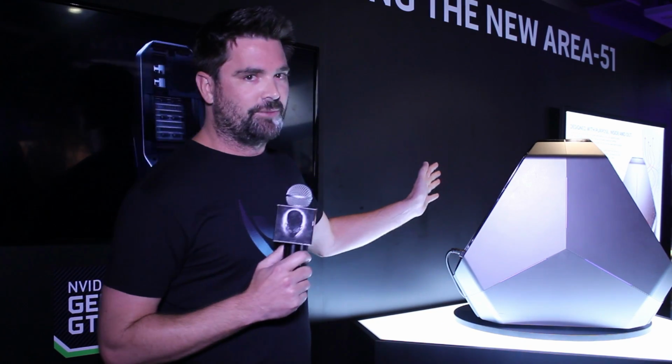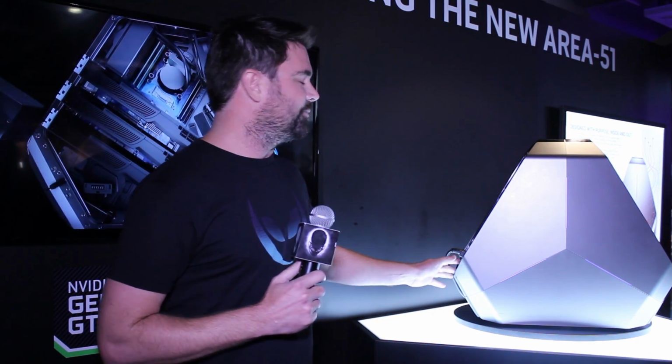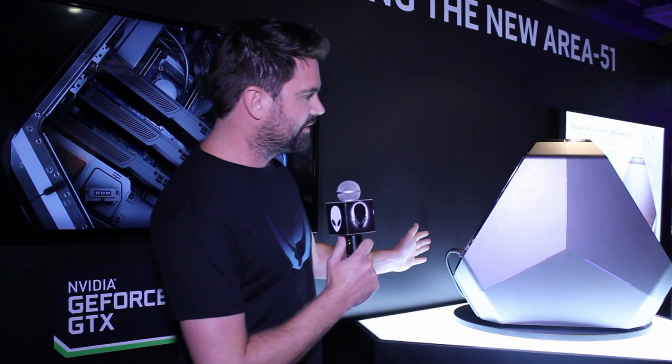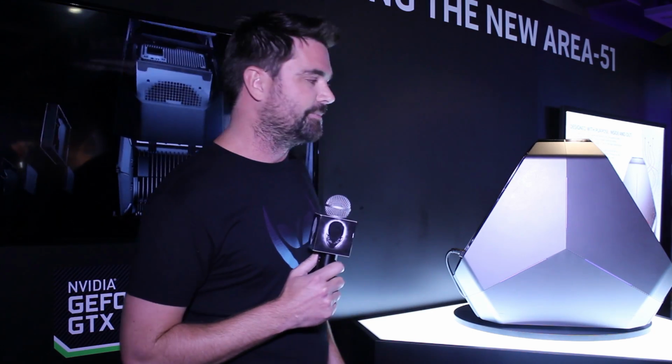If you think about a rectangular chassis, when you slam it up against the wall, you're going to have your thermals exiting right at the wall. You're going to have some recirculation problems. You might be choking that thermal fan. So with the triangle chassis, you end up with this very large, clean air exit. You've got sort of breathing room, if you will.